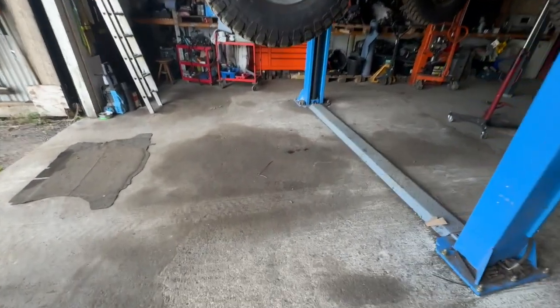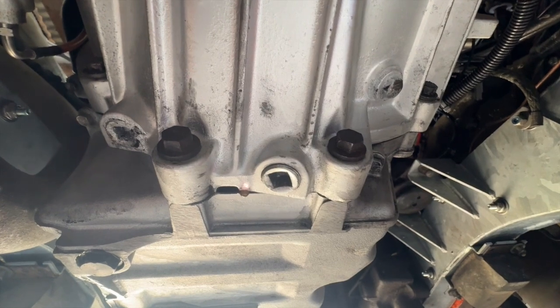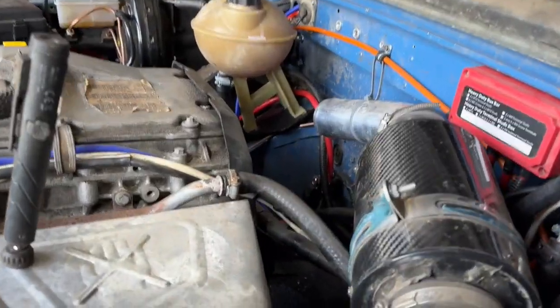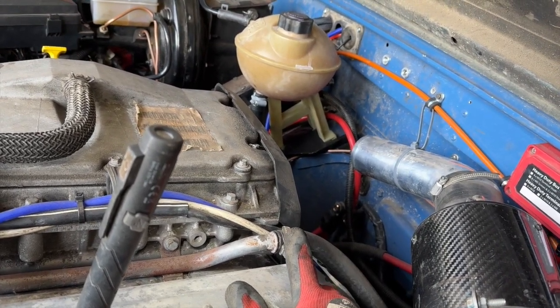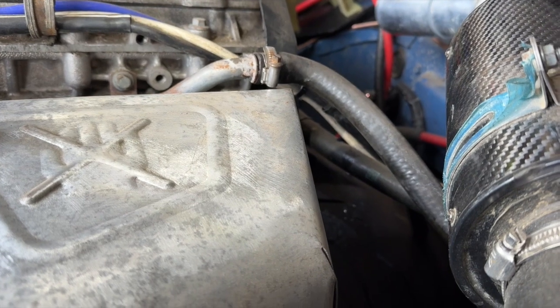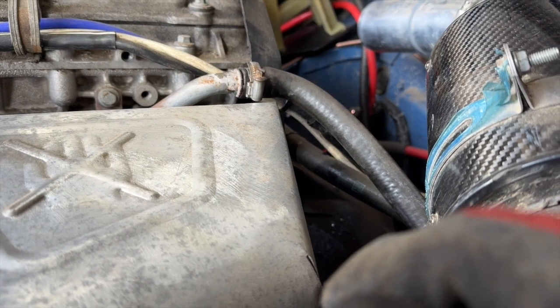We're still looking for our leak. It's been on here for about five minutes and as you can see it's dripping coolant — it's coming out of that little hole on the bell housing. Obviously the gearbox doesn't have water in, so my thought is it's dripping in the top, going around the clutch and coming out the bottom. I think I found the cause — this pipe here that goes off to the matrix was wet. The hose clip was tight as it would go but you could still move it, so there was a gap. I've done this one up tight. We'll see what happens — at least we know in case we need to change that metal pipe.